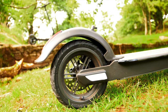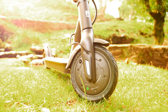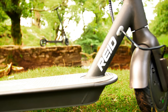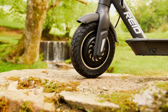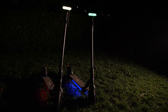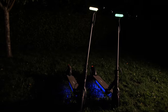Now personal light electric vehicles are commonplace and are popular choices over more traditionally man-powered options, which is why Reed have decided now is the time to electrify. The E4 has 8.5 inch non-pneumatic wheels with a 250 watt single motor on the front. It has a Tesla-esque style HUD up top which controls three speed settings, up to a top speed of 15 miles per hour and a maximum distance of 17 miles. The E4 Plus has 10 inch non-pneumatic wheels and also features a single motor on the front but a total power of 350 watts. A nice touch on both is the addition of a color changing front light and an underglow.